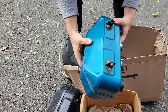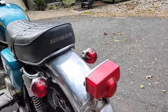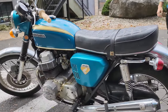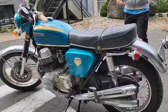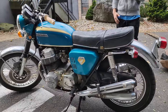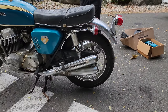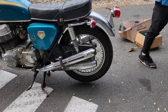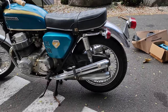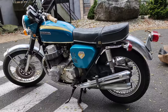Definitely stored in a good environment — it hasn't been cleaned in probably 20 years, since he last rode it. And that may have actually saved a lot of it, not being clean. The oil and stuff ends up saving these bikes — you can see the rear wheel has all the chrome on it because there's chain lube on it. The best thing you could do for a bike parked for 20 years is cover it with a full can of WD-40.